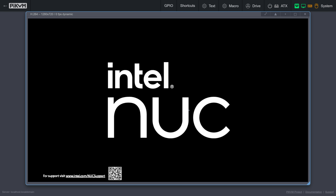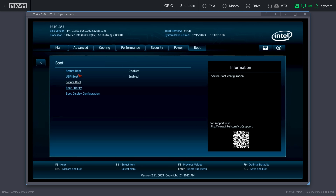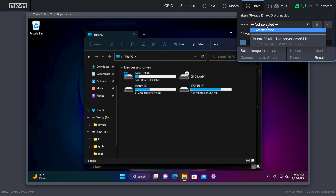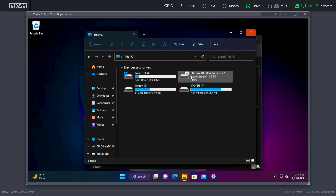Running HD videos probably isn't the reason you want a KVM — it's more likely that you want access to the machine while it boots. I can shut down this machine and then wake it up using a wake-on-LAN packet to power it back on. I learned a ton about making wake-on-LAN work for Windows and Linux, and I'll be updating my blog with complete walkthroughs of how to enable it. If that wasn't cool enough, I can get into the BIOS of this machine to make any changes I want — change the boot order, change boot devices, overclock the machine, and do anything I normally couldn't do without being right in front of it. I can even upload ISOs to the Pi KVM and attach them to the device virtually, boot from it, and install any operating system — letting me rebuild any of my machines no matter what state they're in, no matter where I am in the world, all from a web browser.